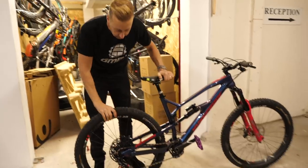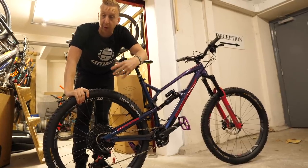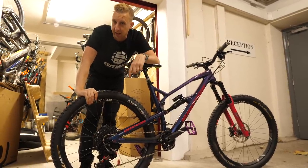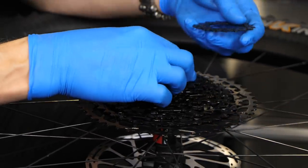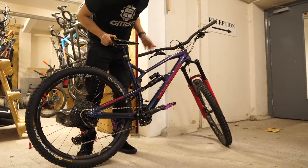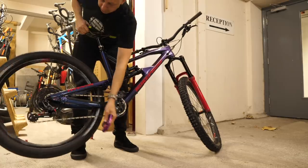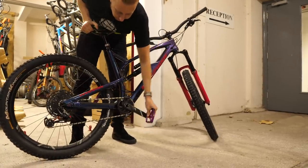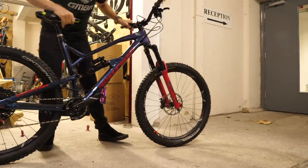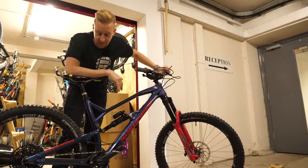Out back, you can't currently fit a proper free coaster design to a mountain bike running any sort of transmission. You might have seen Brett Reader and Brandon Semenuk running free coasters at Crankworx, but they were running a single speed setup. What we've done is take the second and third sprocket off and replace those with blank spacers. On a normal gear, if you go backwards the cranks go backwards. But when you shift onto those blank sprockets, if you pedal forwards it goes forwards, and if you go backwards the cranks stay where they are — so it's effectively like having a free coaster. That means Chris is going to be able to do a whole bunch of really cool tricks. I think that's a pretty cool top mod.